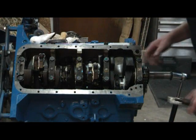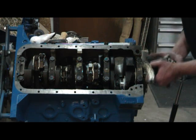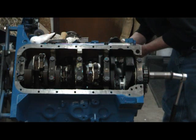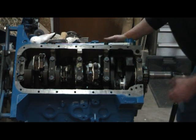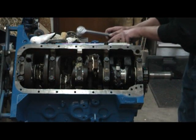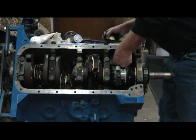I'm looking at number one here and going to the very first one. We know the radius is there, so we're lining our piston up at the radius toward the front of the motor. I've already installed the rings on here. We'll get this started. Now I need to turn the crank around — I like having it all the way out so I don't hit it with the studs.